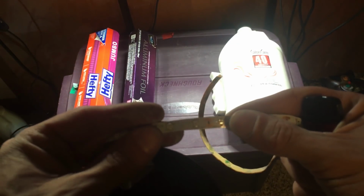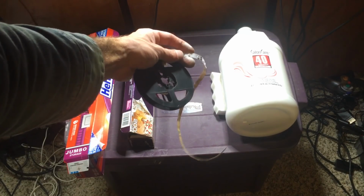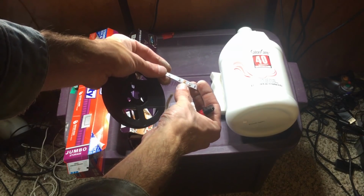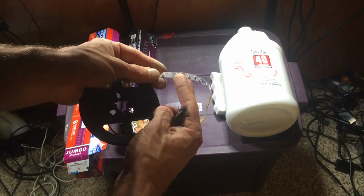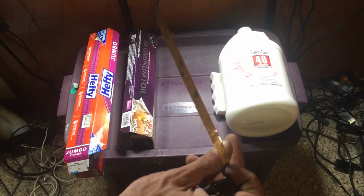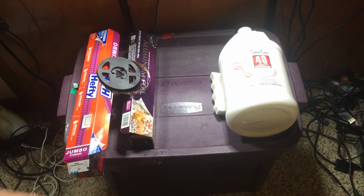These little copper guys here. See if we can have any better lighting. Oh, there it is. You see these little pads? You can snip them there and then use solder to jump them. It'll have a negative and a plus, and then connect them cleanly like that. It's got adhesive on the back. Everything you need.